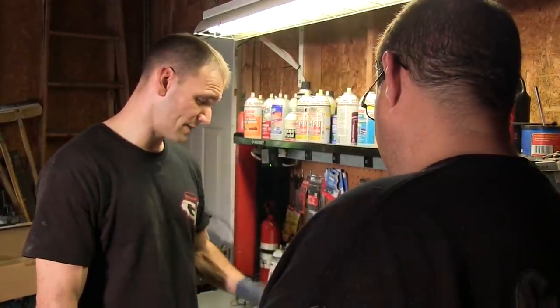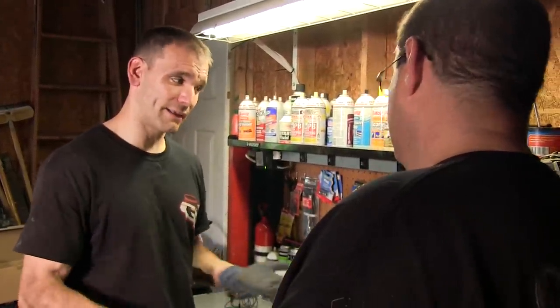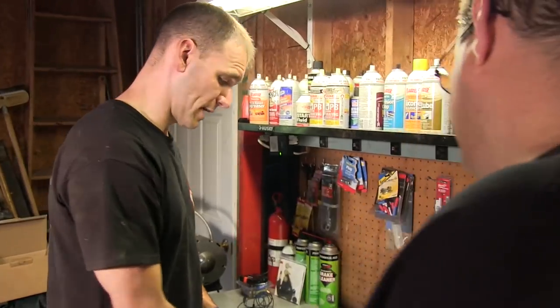At the very least, I want to see where my caster is at, and I'd like the two sides to be close, because if they're not close, then you're going to get caster steer. It's going to cause the vehicle to pull. But let's give it a shot. Let's see what we can do.